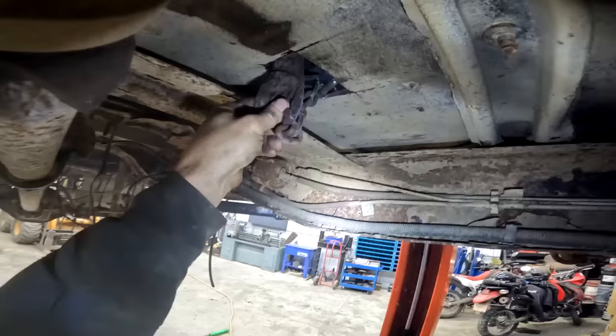Alrighty, so take your fuel cell 500, whatever this thing is, a sending unit. Send that right into the bucket like so. Take this guy, throw her in the back of the truck. Then you can slide your seat forward or back to secure this thing down. Alrighty, well, being that I'm a dump Ford enthusiast, I know red is power and black is ground. Yellow is signal to your sending unit and gray is ground for that.